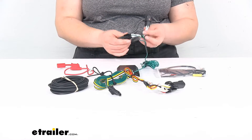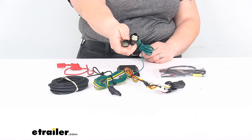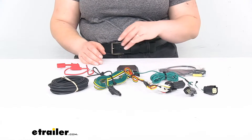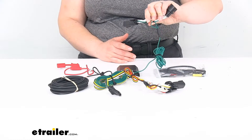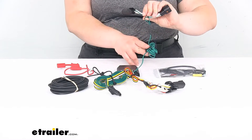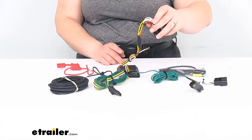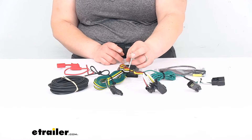So if you have that vehicle, this is going to match up with your vehicle's wiring. All you have to do is get access to the back of your taillights — plug-and-play with the plugs right there. That's where it gets the name T-vehicle wiring harness, since this makes a T. The green wire is going to go for the passenger side, and the red, yellow, and brown go to the driver's side.